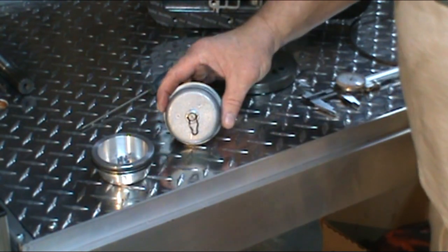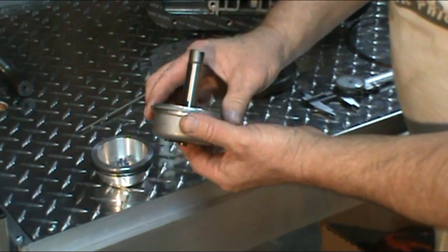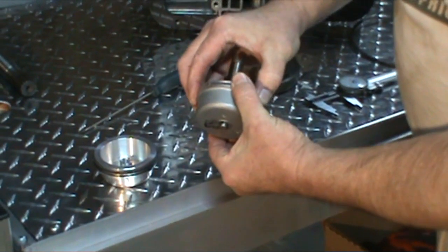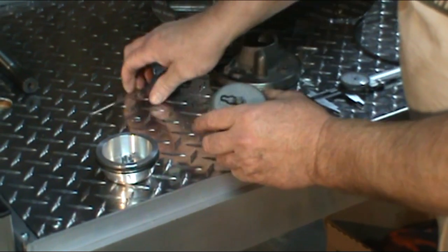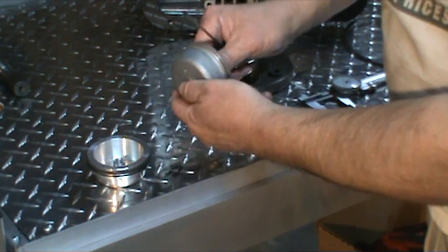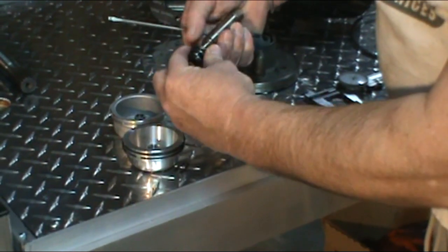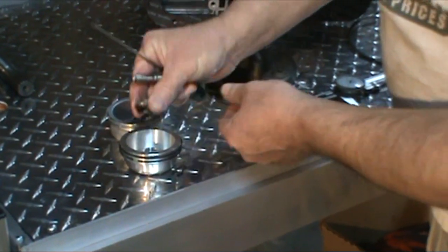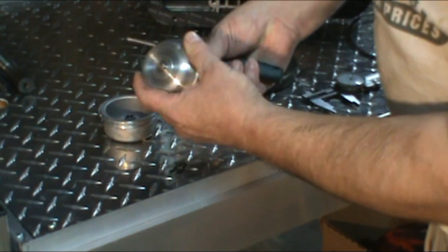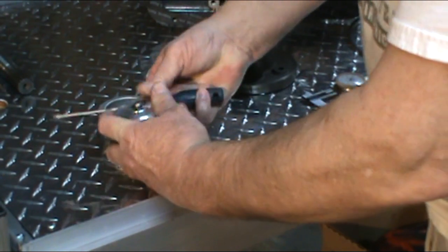Okay, this is another update we're going to do. This is the servo for the band. As you can see, it's got one ring — that's a problem with the stock servo. It doesn't seal properly. It can leak past and give us problems — it'll actually apply the clutch pack in the drum. So what we want to do is just take that clip off. We're going to remove this servo and add the new servo in here. There's a small spring in here — just go ahead and put that back over, a couple of washers on each side, and then apply our clip. And this is going to be much better for the race transmission.